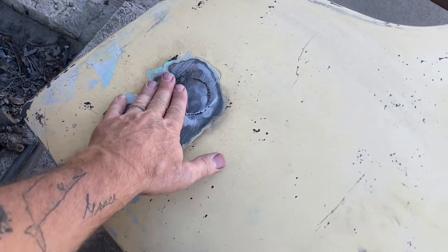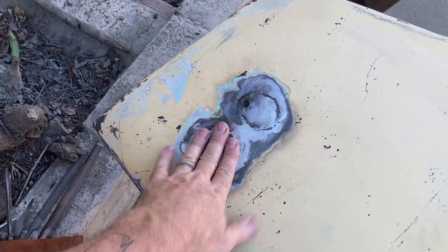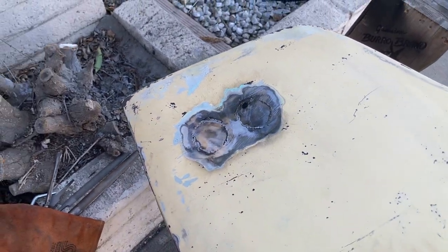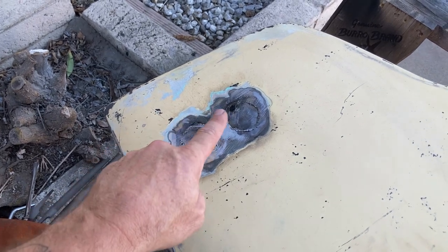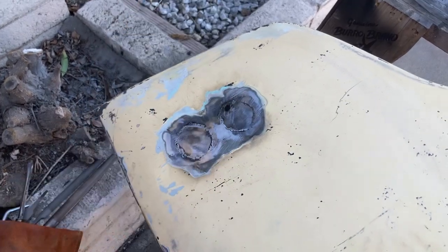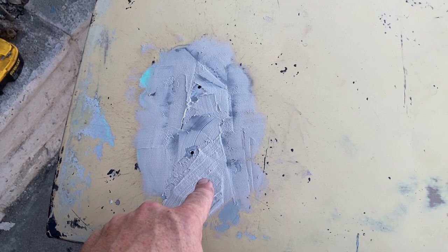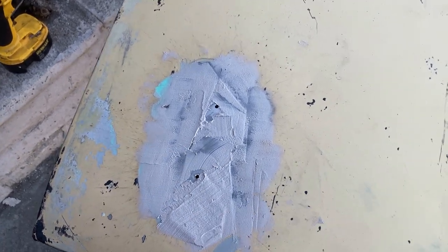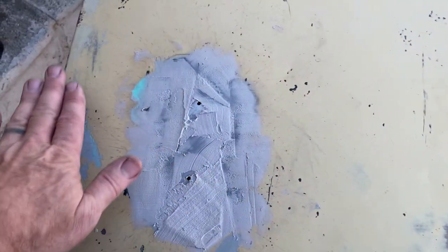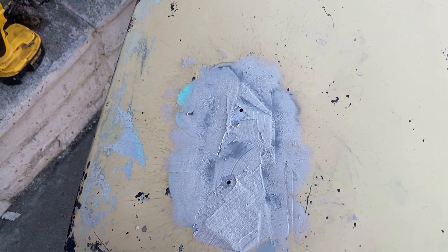It's solid. I am much better at structural — doing the narrow beam on my bug was much easier. It's going into an eighth-inch-plus thick steel tubing — you can give it the spurs and everything's fine. This stuff, I got some warpage here, there's a bit of a dip that I do not like. I'm going to try to pound it out from the back. It is what it is. I'm not welding anymore. There might be some pinholes. A little bit of bondo — had to put it a bit thicker there, maybe at its deepest an eighth inch or 3/32nds, but pretty thin here — just filling in the ridges between the welds. It'll be good enough.